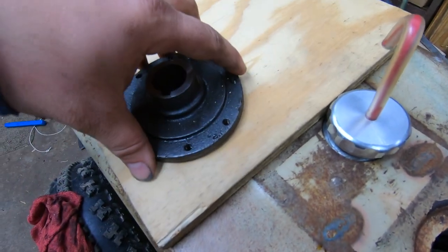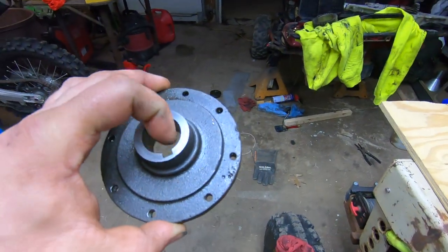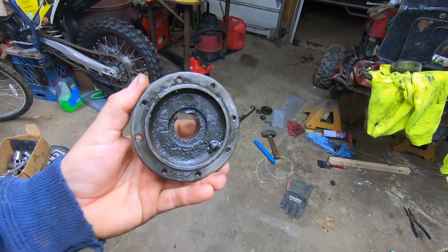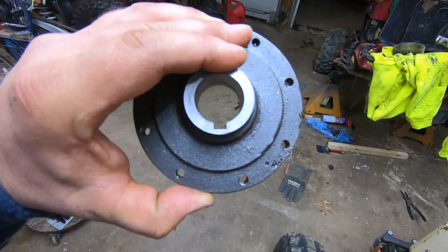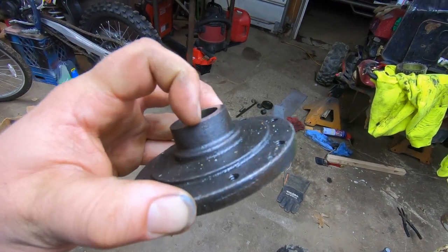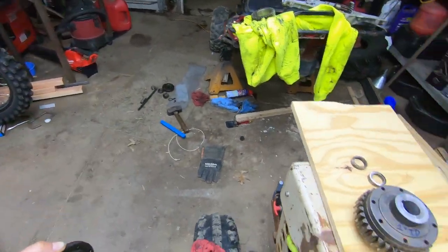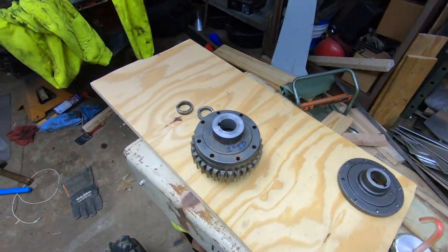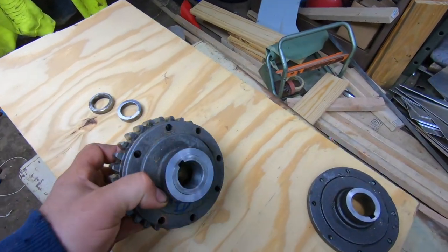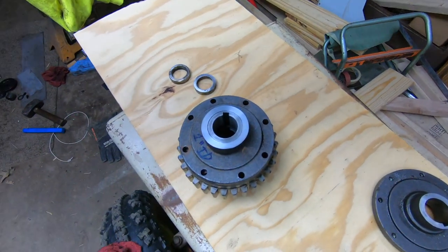That kit comes with new aluminum plates with a keyed plate here. And so I just take the original one, bore it out, and then broach a 1/4 inch keyway in there. But as you can see, I'm running into issues with splitting this hub because there's not a lot of meat left there. So version 2.0, this meaty bad boy of goodness, is going to fix these issues.